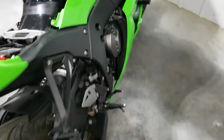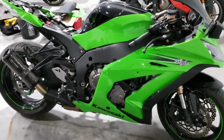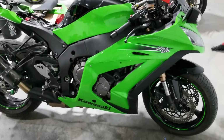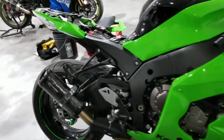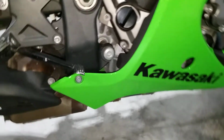This bike is in really good condition for 2011. I'll be putting new tires on it and removing the Two Brothers exhaust and going with a Works 3/4 exhaust. The Kawasaki has really nice exhaust already after you take the mid pipe out, and so it'll be like a full exhaust system,